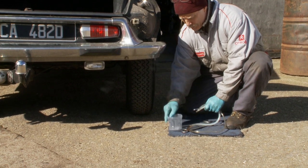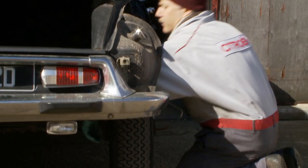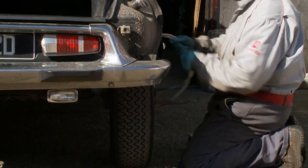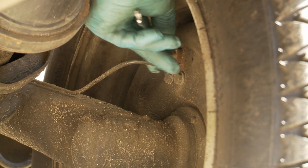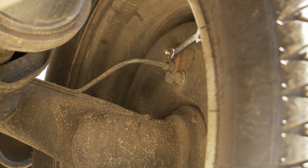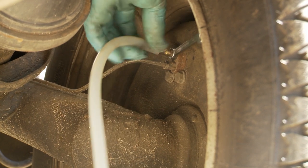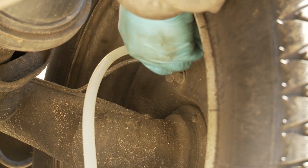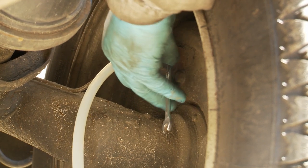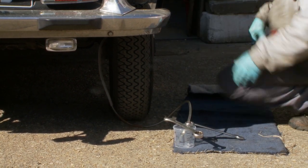What I do is use a little pot, which I hold down with a spanner — most of this I have to do blind. First, you'll find there's a cap on the bleed nipple; put it down safely. Then the spanner, which is 8mm, the size of the nipple. Position it so you can undo the bleed nipple. We then have a pipe which we've previously verified will fit over the bleed nipple without leaking and without falling off. Fit that, then undo the bleed nipple. Put the pipe — using a Heath Robinson mechanism through the spanner — into the pot.